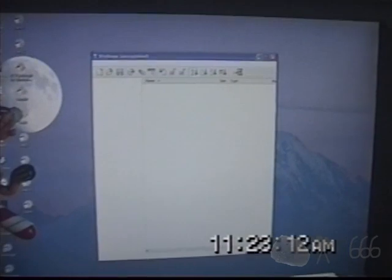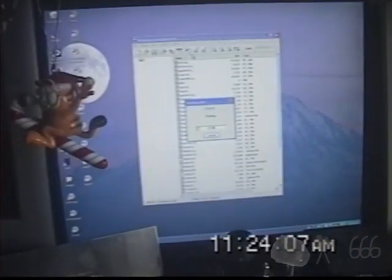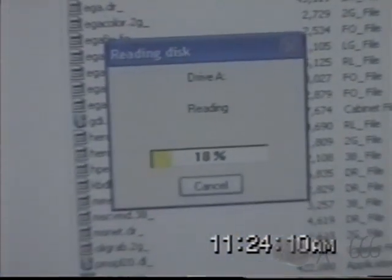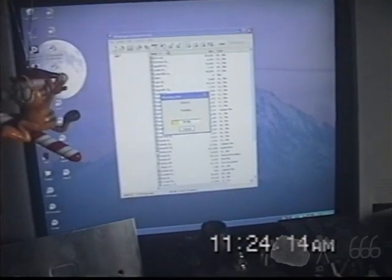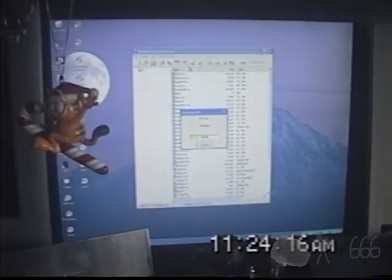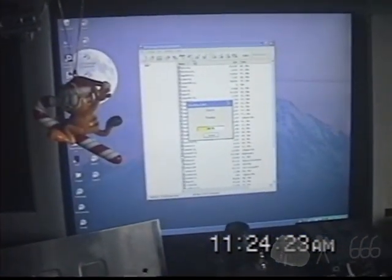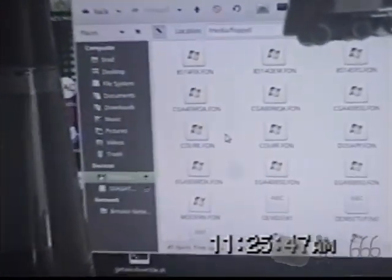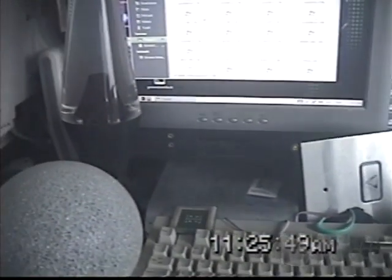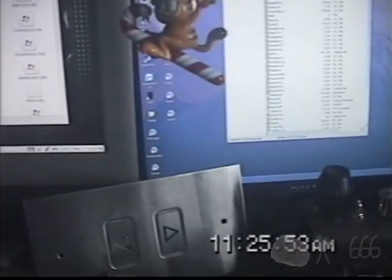We have an issue here — it should be practically instant. Well, this one seems to be working. Maybe that floppy is bad. I'll let it actually read it fully into memory and make sure that all the tracks work, then I'm going to try writing to it. I don't know if this is going to go too well, because this machine actually read that disk that seemed to fail in this one. So I'm going to figure out what this actually is.